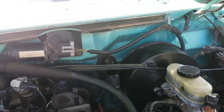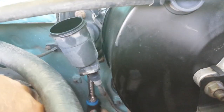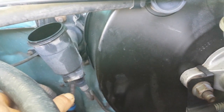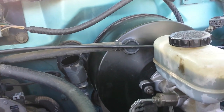Alright, Bridget busted that tough nut up there, and now she's working on the bottom one. Once we get that off, guys, we got it drained. I don't know if you can see, but there's another pin under here. I'm going to pull the whole line and everything and feed it out through up here. That way we can put the other one on and then just slap it in. And I'll bleed the system on here and show you how we do that. It's a time process.